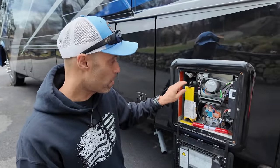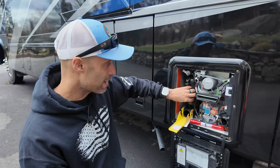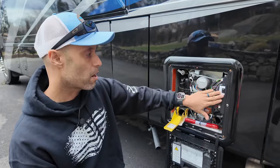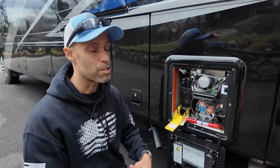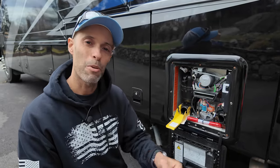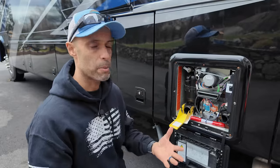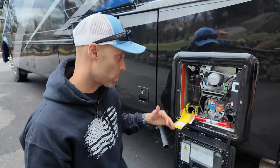Made in Germany, guys. Really awesome. Like I said, it's a tankless water heater, but it does have a one-liter tank. Normally, when you turn it on — it's off right now because we are winterized — you put it on eco or you put it on comfort. If you're stationary and you put it on comfort, it's gonna keep everything warm. When you're going down the road, especially if it's really cold out, this only runs on propane. And remember, you want to shut that propane off when you're going down the road. Therefore, you would have to winterize this every single time if you're going down the road in really cold conditions, or this could be subject to getting damaged because of the cold.